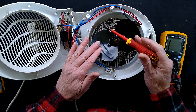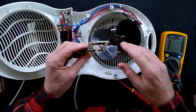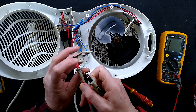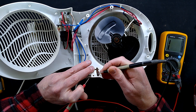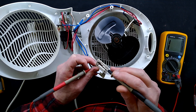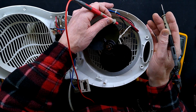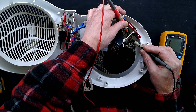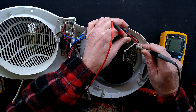I've procured the driver - this isn't my normal bench so I don't really have all my tools here. Here is the first thermal cutout. It's unusual to find one this side; it's usually just the ones down here. There's one down here with a thermal fuse - I always thought it was the thermal fuse that was away, but it appears to be this one. There's no continuity through the contact, so that's a burnt or dirty contact. This thing's a bit corroded, to be honest. I wonder if it's just suffered corrosion damage. There's a second thermal cutout down here that I can probe - it is also seemingly not making a good connection. Is everything just corroded in this? It is. That's dire.